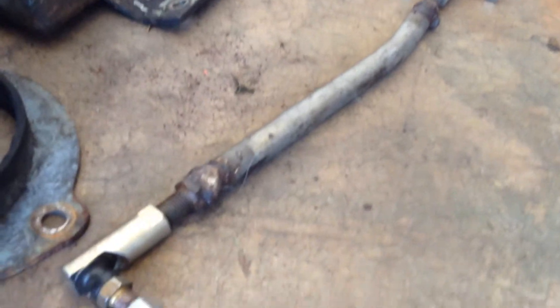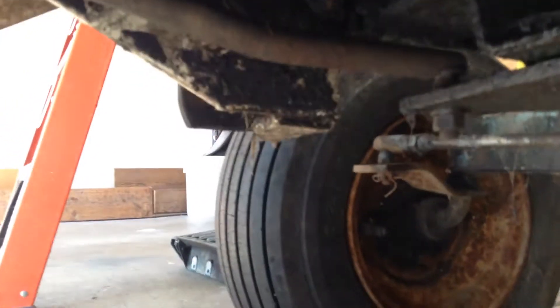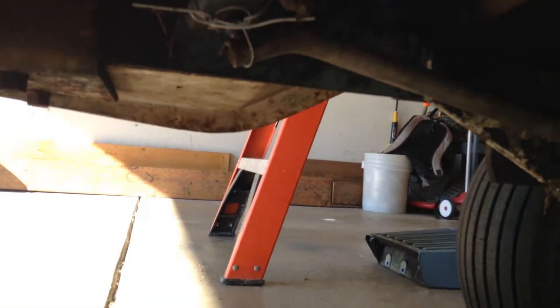Another thing I did — I grabbed this old drag link out of the attic that I had on the Orange '68. When I swapped that out, because this is worse than I thought, guys — they either got it all wired up on there and they also got a piece of garden hose holding it on the top. So I'm going to be taking that off and putting the other one on. I'll adjust it out and put some jam nuts on it to hold it. Yeah, I can't drive around like that.